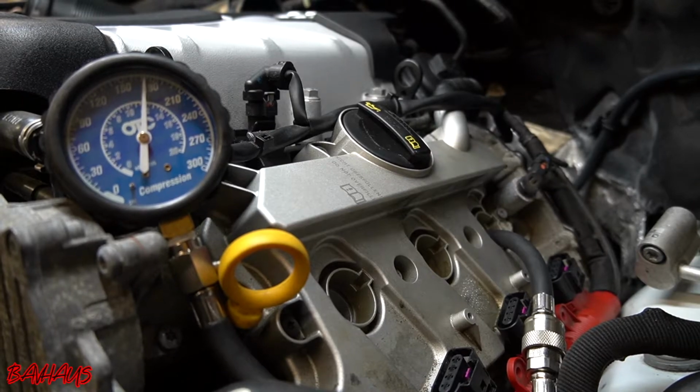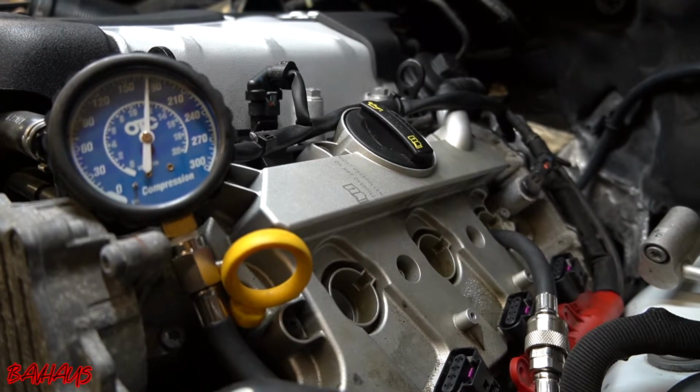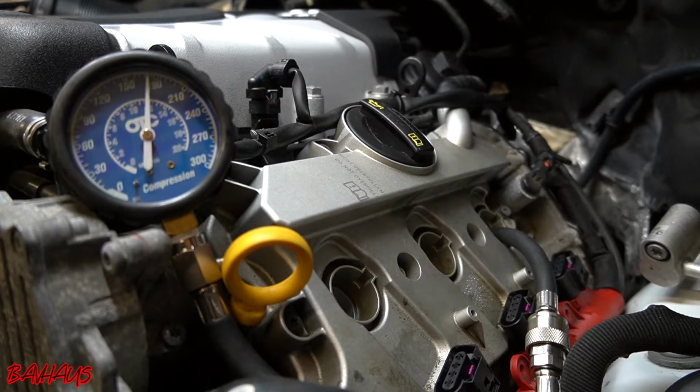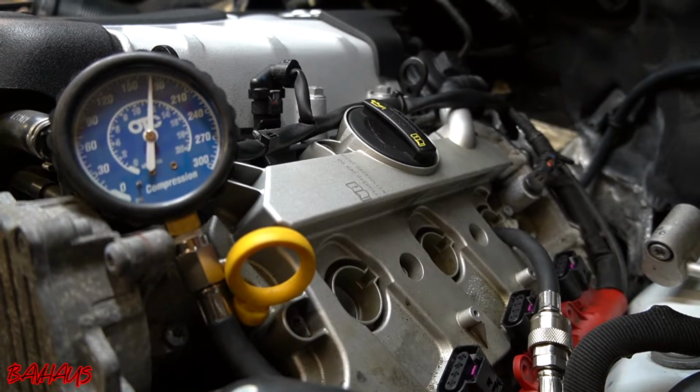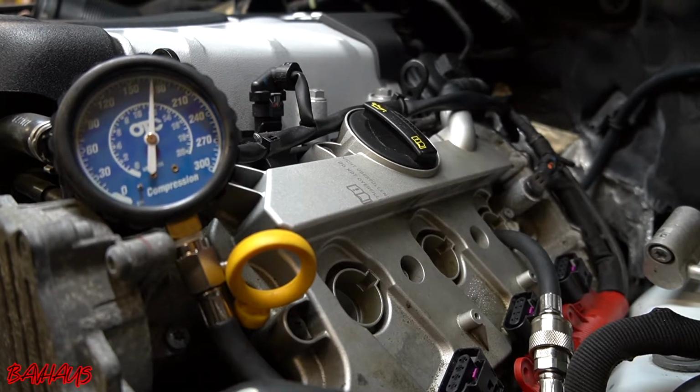So I'm gonna take my recording of 170 PSI on cylinder 6, and we're gonna link back up with you guys in just a bit.